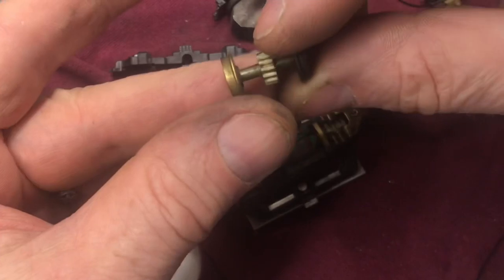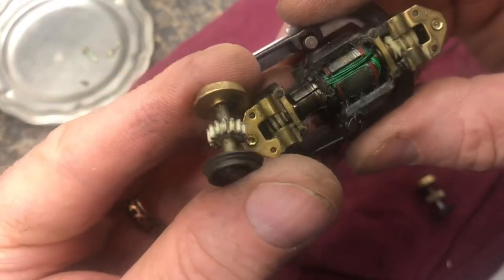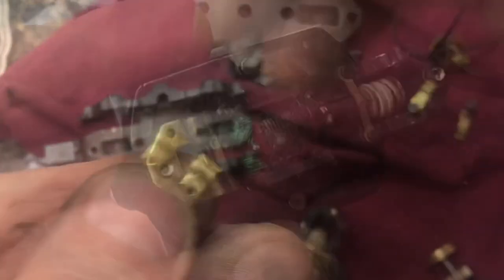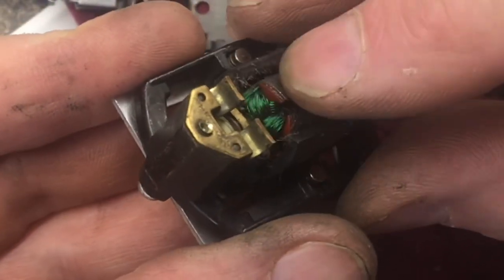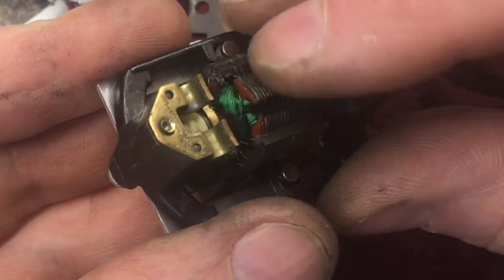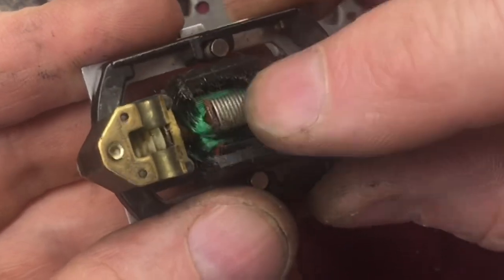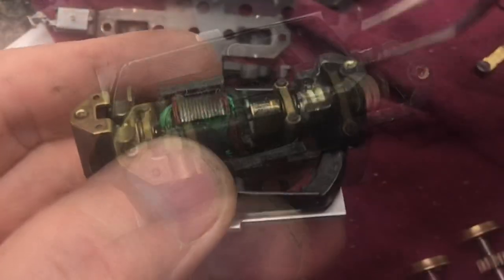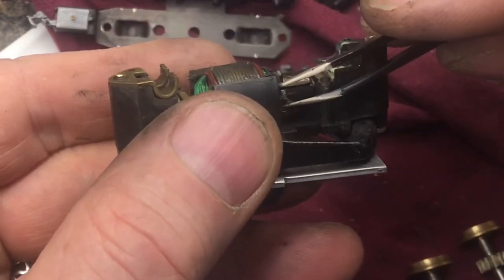The wheels we can pull off — you can see everything's really dirty in there. When you pull the second wheel out, you can see just how much dirt is in there. Remove the brass so we can see the worm gear. When you spin it, you can see that it just freezes and locks sometimes — it's all that steel wool jammed in there. It's not even moving.